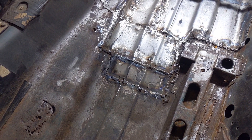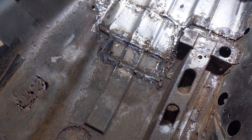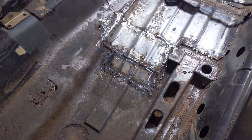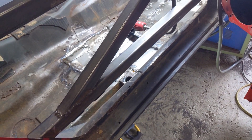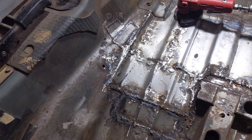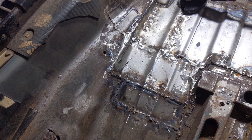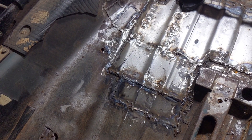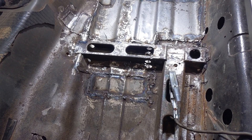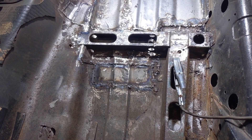I've started today by finishing getting that piece in place — I'll give it a bit more of a grind down but not too much. Welding is much easier when you clean off the nib and the shroud and replace them with brand new ones — suddenly it starts working again. I've also welded completely underneath, so it's been welded on both sides. I need to give it a bit of grind underneath still, as I've got a few bits of wire sticking through from when it didn't stick initially. That piece is in place, so I can now consider the floor done and we're going to start on the transmission.